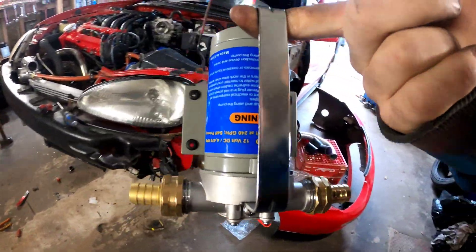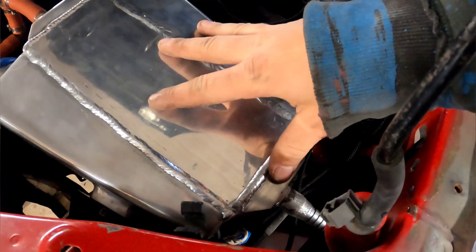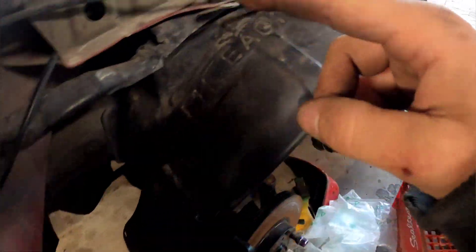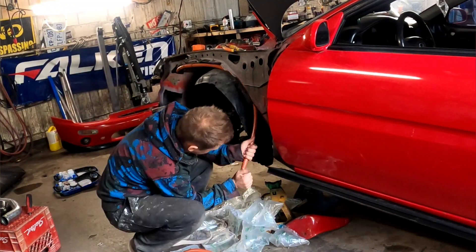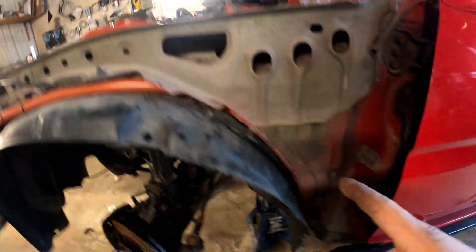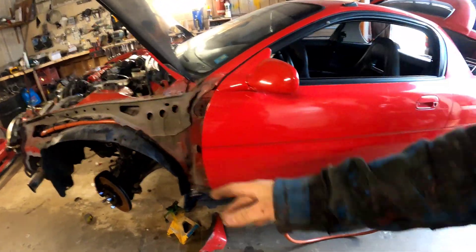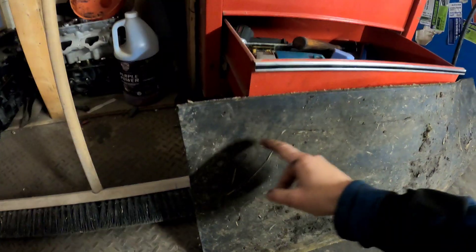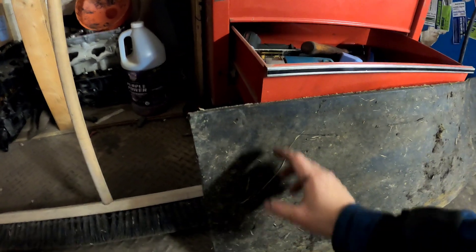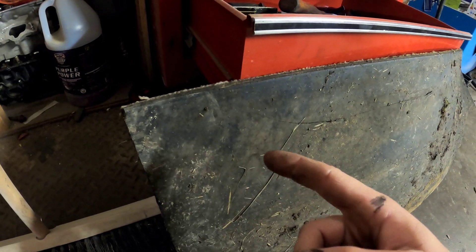I definitely want to mount this pump outside of the car because it is loud — I don't want to be hearing that while I'm driving. I'm thinking I'm going to mount it underneath the trunk. I've got to put this hose around the wheel well and then underneath the car so I can mount this water pump where it isn't loud and annoying. I got the car jacked up and tidied up all the lines. I'm going to cut a piece out of this rubber mat — it'll deflect sound from the vibrations of the pump — and that's where I'm going to mount my pump to the car.